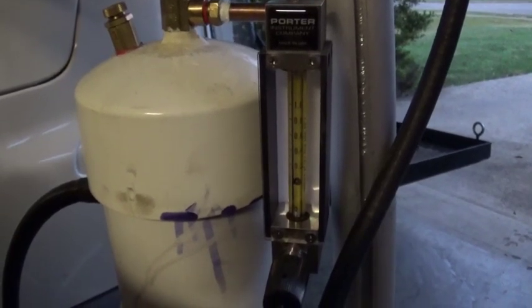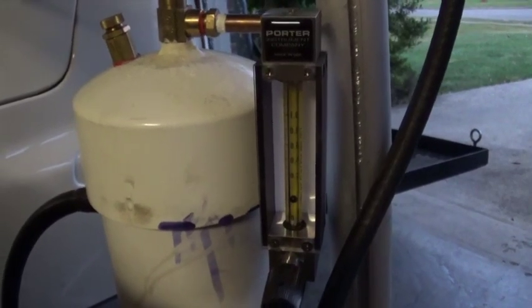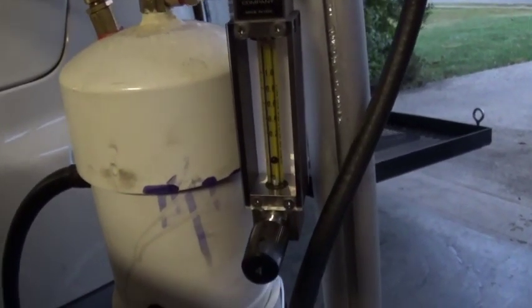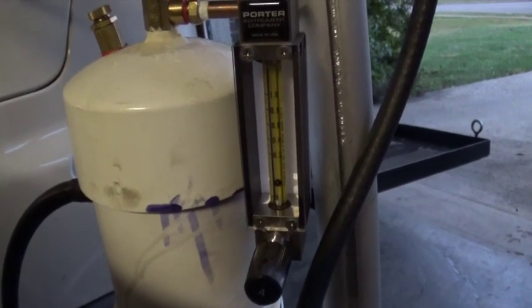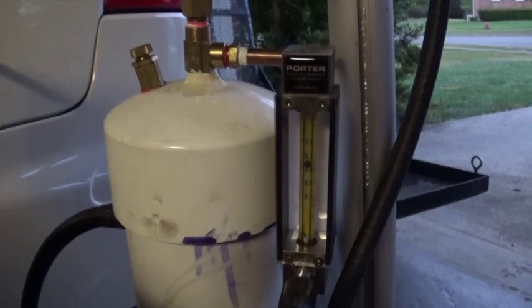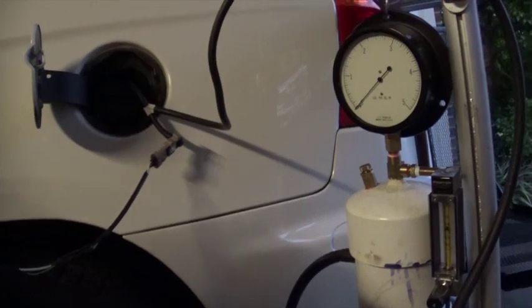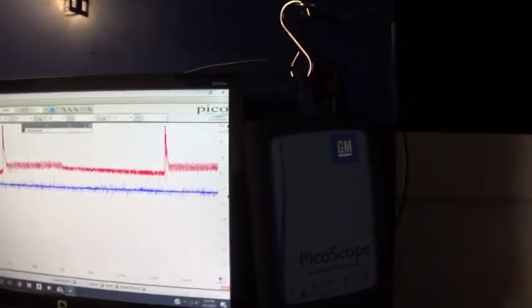My smoke machine is not 100% sealed, but it's good enough. It'll drop eventually. It's fine. I'm just making sure that I don't overpressurize, so that's fine. I'm happy with that. So I'm going to open up the line and see if I can pressurize the system. Also I have my pressure here. It looks like around 1.1 inches of water actually, which is pretty good.